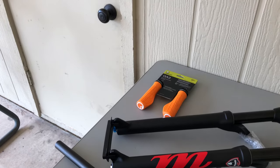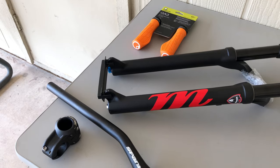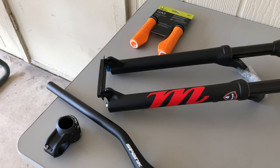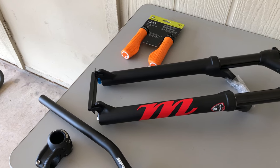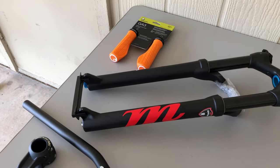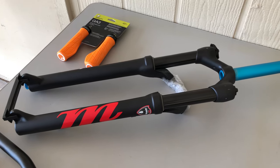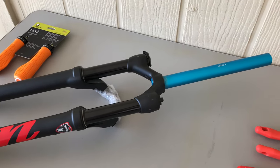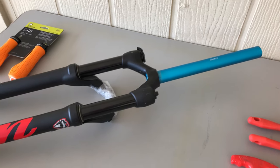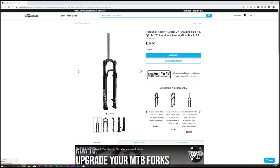So why replace a coil fork with this air fork? The main reasons are weight, adjustability, and rebound. Coil forks are heavy, the only adjustability comes from replacing the springs, and they offer no rebound. The Manitou Markhor was affordable at $225 and almost a pound lighter. It came with an option for 120mm of travel. I could have purchased a similar RockShox Recon fork, but it only offered 100mm of travel for non-tapered steerer tubes and quick release wheels.